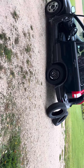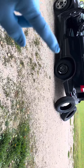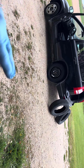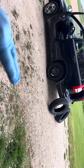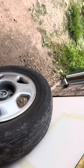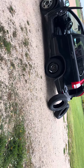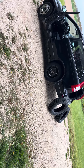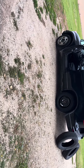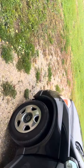I actually just replaced all four struts. What causes this to happen is when the strut or the spring is not fully putting force down on the tires, causing it to bounce as you go down the road. The rear struts — this is the rear tire — were both leaking oil very, very badly. You could almost take the whole tire and lift it up by yourself with very little resistance. In the fronts, they're not as bad because you have the weight of the engine and the transmission on them to help keep them stable.